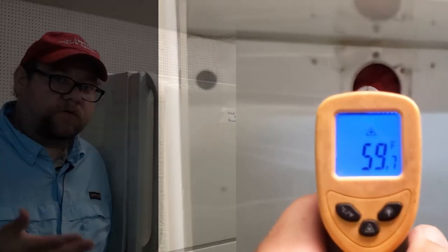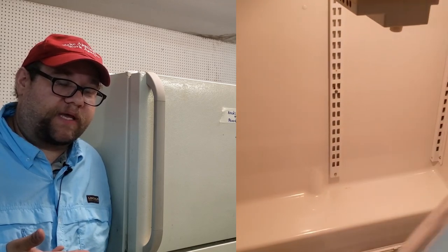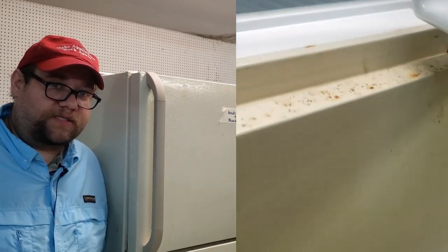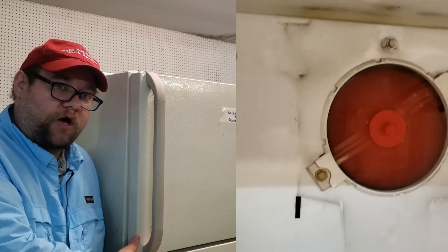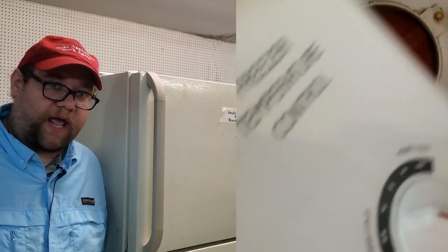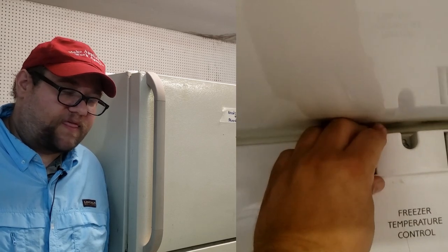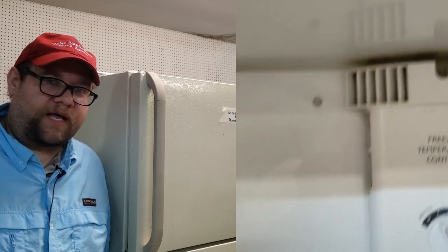Working on this so far is not quite as elegant as I had hoped — it looks more like a hack job. But what I'm really concerned about is making sure we can get this freezer to start freezing in the refrigerator part, and you need a lot of airflow to do that. The air tower is not in the condition we want. I've already ordered a new air tower to route more cold air to the bottom, but we're trying to prove the concept of how to convert a refrigerator to a deep freezer. We'll come back in the morning — about 24 hours — to check temperatures.